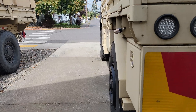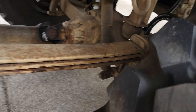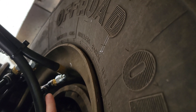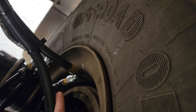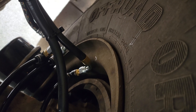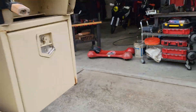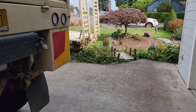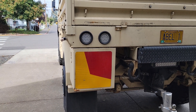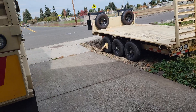One thing I forgot to mention: when you're putting this kit together, make sure you rotate your cans because the fitting on the back can on both sides runs really close to the wheel. But if you rotate your cans forward you'll get about an inch to an inch and a half clearance on that - just something to be aware of. Now I'm going to get in the cab of the truck, start it up, and do a test to see if there are leaks, if the parking brake doesn't release, or any of the multiple things that could happen when you change the system like this.